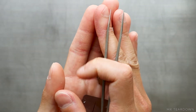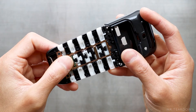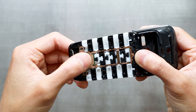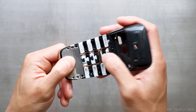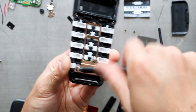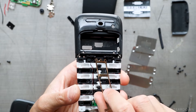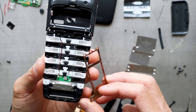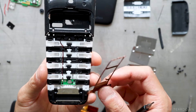I do know why the stainless is essential in this design. Imagine if it weren't here — when bending the mouse, your thumb would push the grippy rubber skin up against the bronze bracket, stopping it from sliding smoothly. The stainless separates the rubber from the bracket and provides a low-friction sliding interface. We have two screws holding down the bronze bracket, which can be taken out after some wiggling. Bronze is chosen here because it has a low coefficient of friction on plastic and stainless, and there is also a tiny bit of grease on the surface to help reduce friction further.